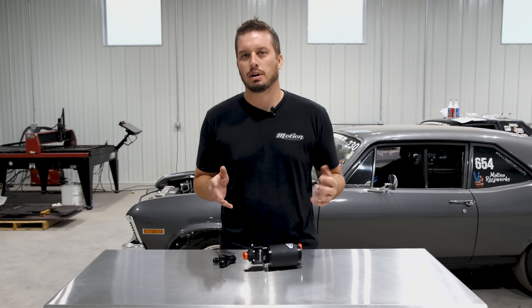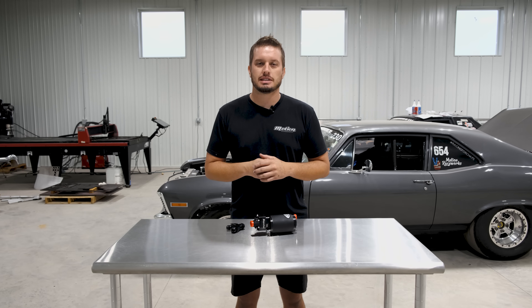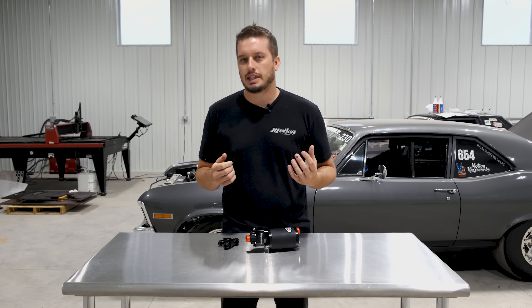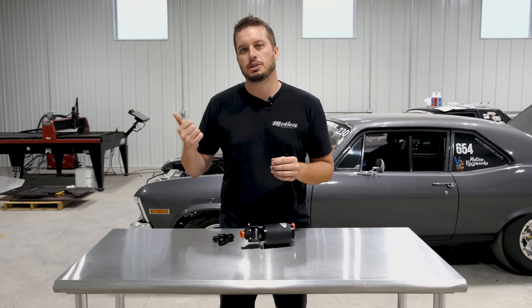The outlet side is actually a lot simpler — you can Y that right into it, assuming your feed to the rails is the correct size. For instance, on this Magnafuel 750, if you have a number 10 feed to the rails, that's fine. Y these two pumps together after the outlets and go to a number 10 right up to the rails. You do not want to run two lines individually to each rail. If one pump fails intermittently, or if you want to use just one while you're driving, you're only going to feed one side of the rails — that can burn up one side of the motor. Running one feed line to one side of the fuel rails and one to the other creates inconsistent pressure and leaves variables that cause tuning issues.